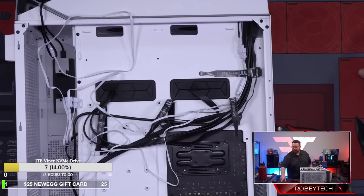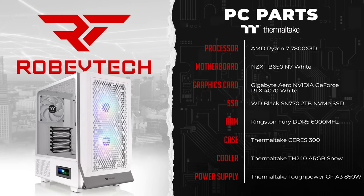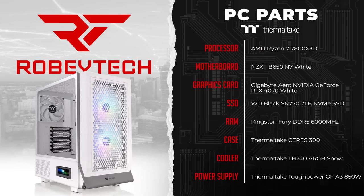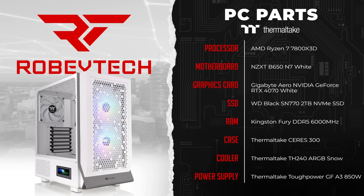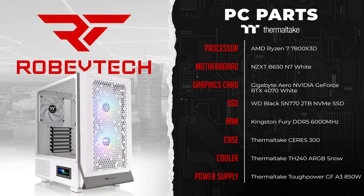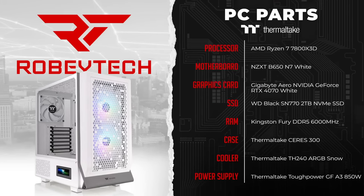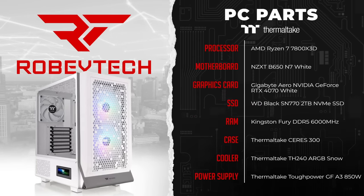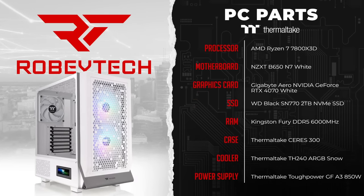And for the people who don't know what parts we're putting inside of this, here is the build we're doing again. We're doing the Ryzen 7 7800X3D. We're doing an NZXT B650 N7 white as the motherboard. For the GPU, we're using the Gigabyte Aero NVIDIA GeForce RTX 4070, also in white. So again, an Arctic build going on with this whole thing. We have WD Black, it's an SN850X actually, not a 770, so it's an SN850X for the NVMe. Kingston Fury DDR5 6000 megahertz EXPO RAM in white for our memory.